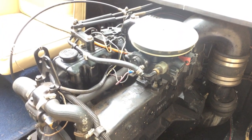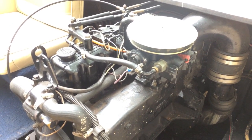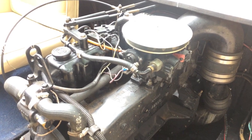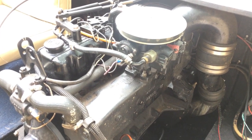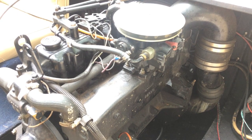What we're going to do is start this engine and warm it up for about 10 to 15 minutes. That's going to warm up the oil, loosen up the viscosity, and move any sediments or debris inside the oil down to the lower portion of the oil pan.